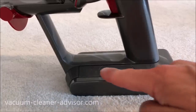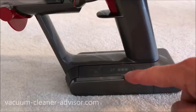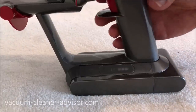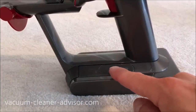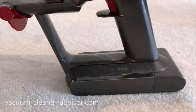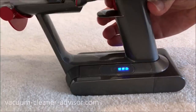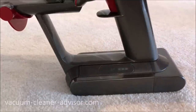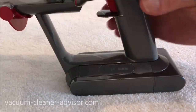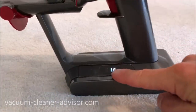Above the battery there are three bars for battery level — fully charged, two-thirds charged, or one-third charged. Depressing the trigger, we can see all three bars illuminated, meaning it's fully charged. There are also a couple of indicator lights: one tells you if there's a clog issue, another if there's a potential filter issue. Unseating the filter and depressing the trigger shows the filter light blinking; putting the filter back makes it go away. Simulating a clog shows that clog light blinking.